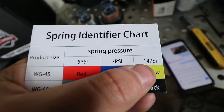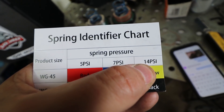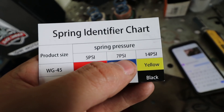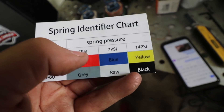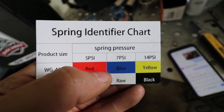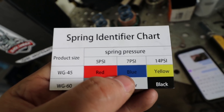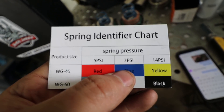I'm going to call him Nick. It's like the first time I've ever called anybody and nobody wants to answer me. I'm kind of stuck on what spring I want to run. I don't really want to run a 14 psi base spring, but I also don't really want to run a 7. So I might run the 7 and the 5 together, which will give me 12 — which is like a good number. I was thinking like 10, because I want to make 800 wheel on pump gas and boosting, or pump and the octane additive stuff.